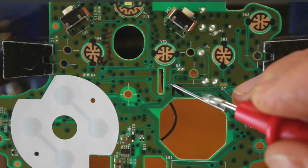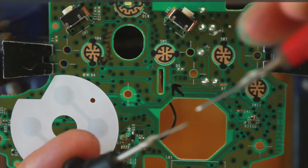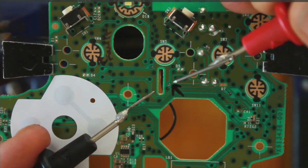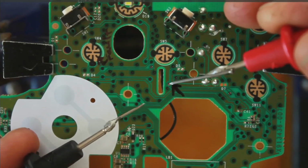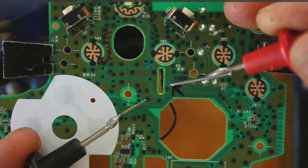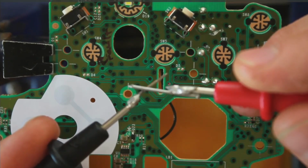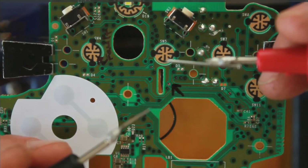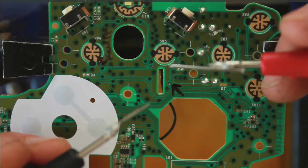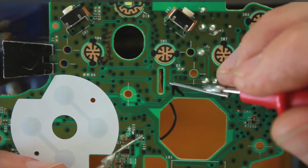I think this perforation hole here, when I connect these on either side of this board on that same point, I don't get a clear continuity. I have to push very, very hard to get a continuity. And even then, the resistance in ohms measures quite high. On a regular line, you should get an ohms reading of about 0.7 or definitely under 1 ohm. I'm going to try to repair this connection here.